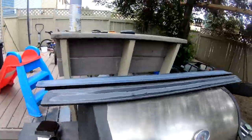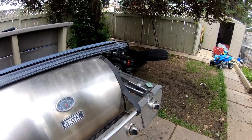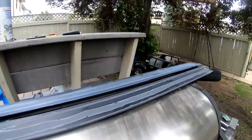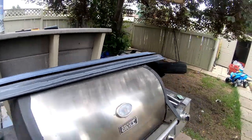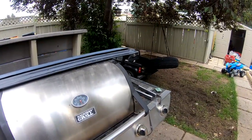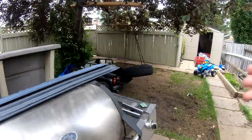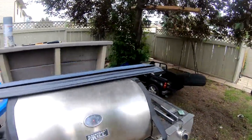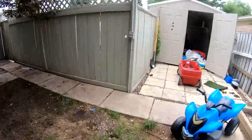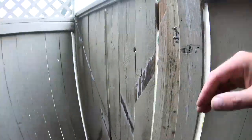So if you're wondering, yes, I'm gonna keep the paint the same color, the hood the same color. I'm just gonna touch up these here that need to be painted, and the fender and the door there, I'm gonna touch that up. I'm gonna go get it because it's really rusted in one spot. It ain't a big spot, but it's fairly big. So what I'm gonna have to do is sand it out, maybe cut that area out, fiberglass it, then put some body fill over it, right?